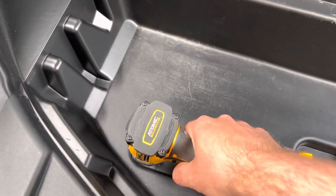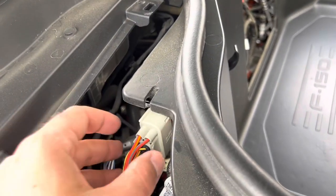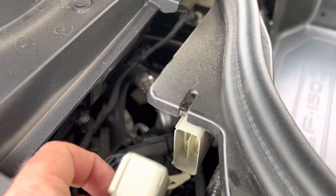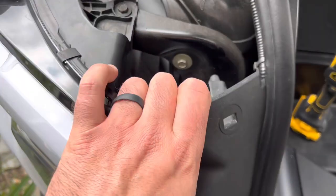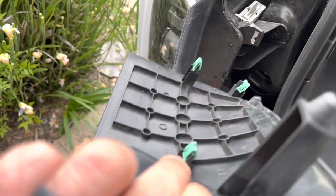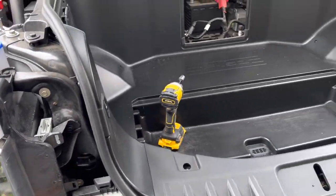Once you get those off, there are two 13mm bolts down here — we'll zip those off too. Then we're going to unhook the power going to the front: over here, push the pin in and pull it — need two hands. That's the only real connection to the truck. Then we're going to take these plastic pieces off in the front. They're going to pull out — be really gentle though. I actually broke one of the clips on the bottom, so you can see they're just push pins. Pull them straight out if you can.